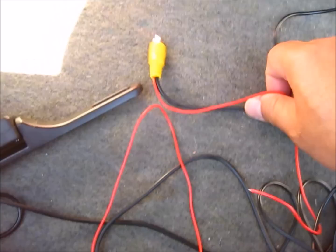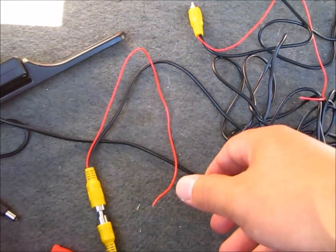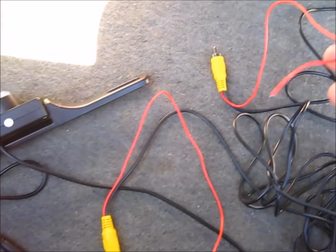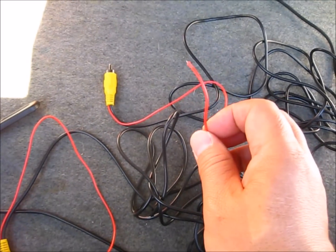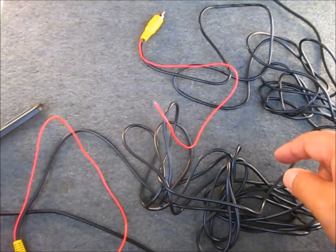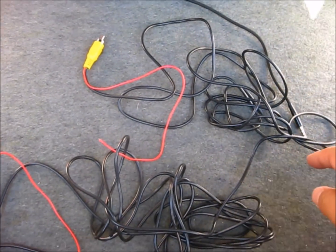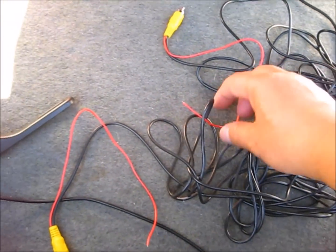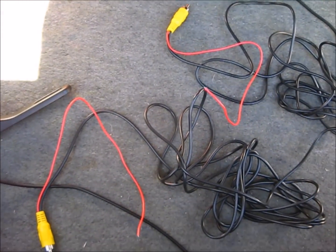The red pigtail wire here is going to allow you to tap into the backup light power, and this on the front is going to hook up to that pink wire on the head unit. This red wire initially is confusing. It's nothing different from a parallel wire running inside this black cover. It's a pretty nice little feature. Otherwise, you're going to have to run two wires.